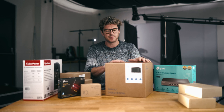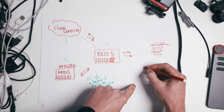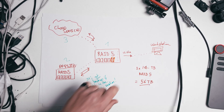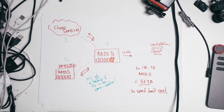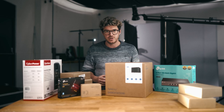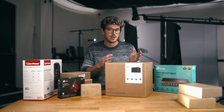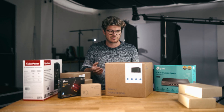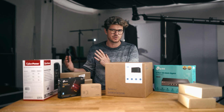As I mentioned, I have the system equipped with five bays. I have five 14 terabyte Seagate Ironwolf Pro drives in there, which built in a RAID 5 array gives me a total of about 56 terabytes of storage capacity, with an approximate three times read speed boost compared to just one of those drives spinning on its own. There's no obvious write speed boost, but for post-production work that's not a problem because we're not writing to the rushes, we're just reading them.